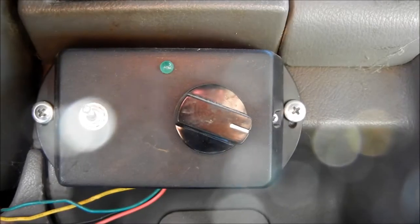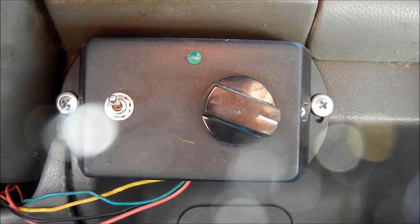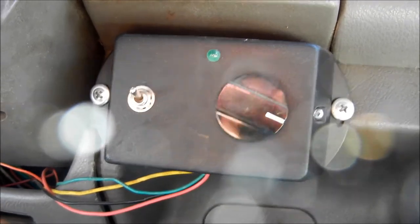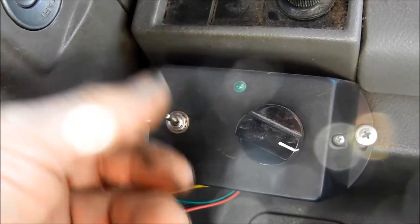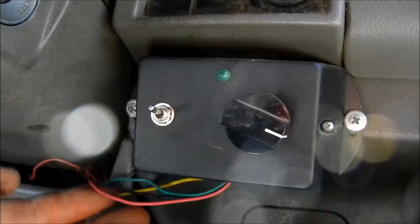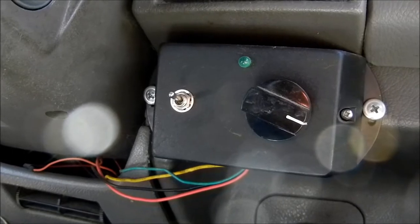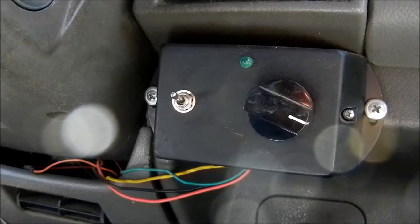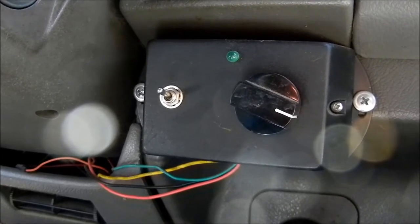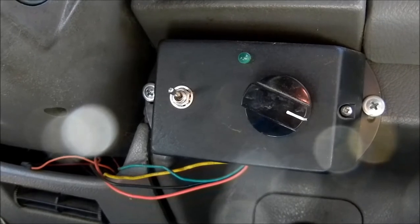This is my little hydrogen oxygen experiment — my O2 adjustment for my HHO system. I bought it off eBay for about 80 bucks. It had an on/off switch and a couple of lean settings, and it hooked between the O2 sensor and the truck computer. Basically this thing burned out after about a year — toast in about a year. I tried to look up the seller on eBay and they were no longer selling them. So all I've done since is run the O2 sensor straight into my computer, and it's working that way.